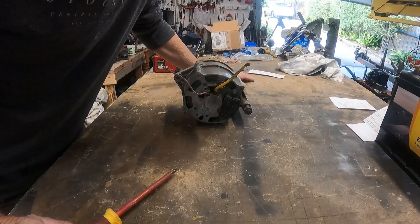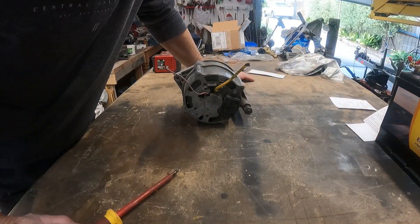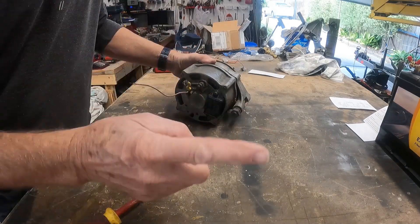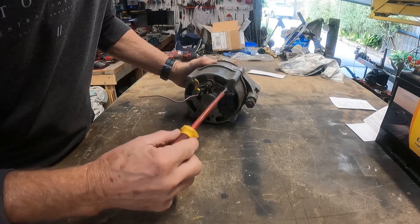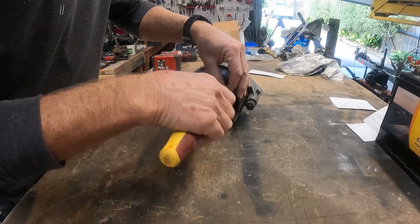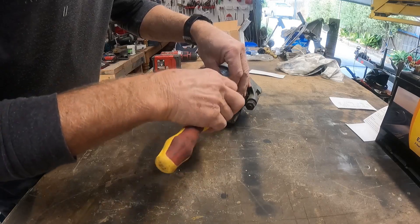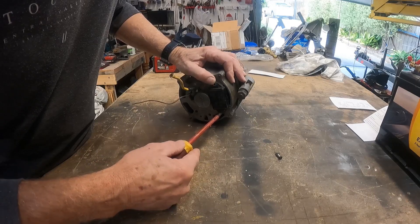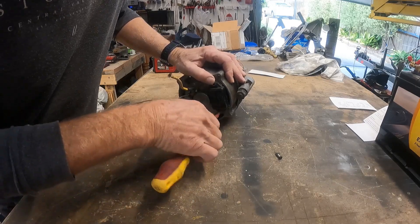Alternators 1.1: The most common reason an alternator fails. So you've tested the alternator and it's still not charging — the number one problem is the brushes. These alternators are really, really good because you can undo the whole brush module and regulator module and replace the whole lot quite easily.